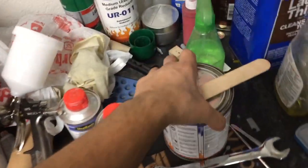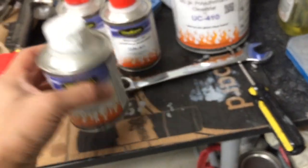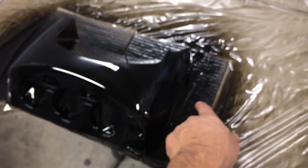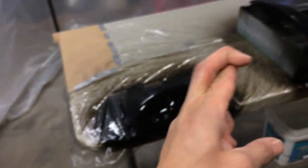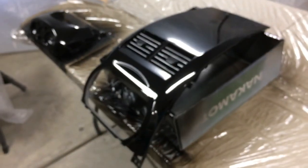I do have some bad news though — I realized something, and this is the stupidest thing that has happened to me. By accident I mixed the reducer with my clear coat and I did one coat on all these pieces using the reducer mixed with the clear, so it ended up being a 4-to-1 ratio. I was like oh shit. I got the wrong ratio, so I'm hoping this thing doesn't turn into a gummy mess. I'm waiting for it to dry — I'm feeling the areas where there's overspray and it looks like it's kind of drying, so it seems okay so far. I'm crossing my fingers. Anyway, thanks for watching guys, and I hope you catch the next episode of my screw-ups.